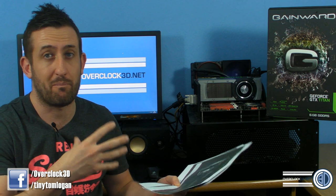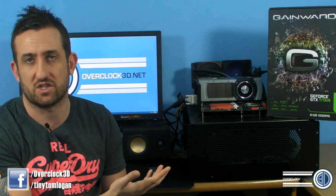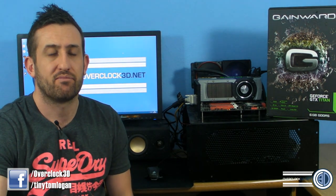They've essentially said, okay, this will do the absolute best that we possibly can at this present moment in time with this architecture, and they've worked everything around that. It's a no-holds-barred graphics card, which is why we've now got 6 gigabytes of GDDR5 memory buffer. That's an absolute dream for really high AA and really high resolutions. 2560 by 1440 is what we've started doing a lot of our tests on, but 2560 by 1600, or triple surround, 5760 by 1080 screens, if you're going down that route.